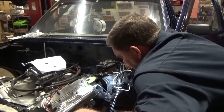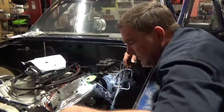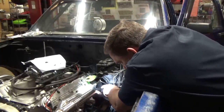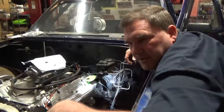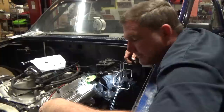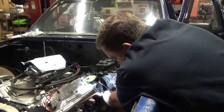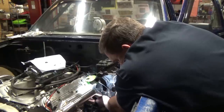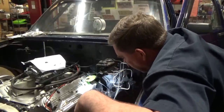Next order of business is the steering column — that thing that attaches the nut behind the wheel to the car. With these up-and-forward headers, my column comes out right here and goes right into the tube. I originally thought I was going to move it left and down, then realized there's a brake pedal in my way, so I have to go straight down. I'm going to modify the column that was in this and change it so that my output shaft comes out right about there, which allows me to put my universal joint there and connect it directly to the steering gear.